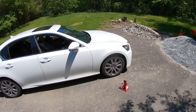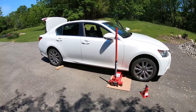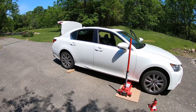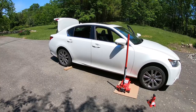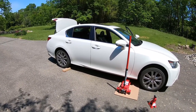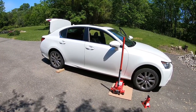We begin by lifting up the car. I've jacked up the car and chocked the wheels. This part is extremely important, especially if you're using the scissor jack that comes in your car. The moment you use that thing and lift up the car it becomes very unstable, so please chock your wheels. Make sure the car does not roll in any direction — trust me, it won't be fun if it rolls off that jack.